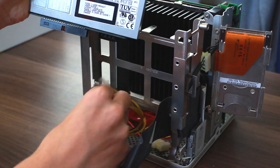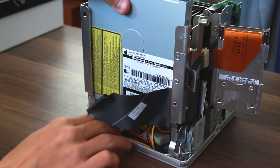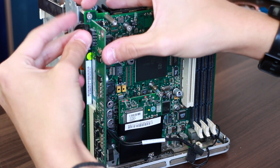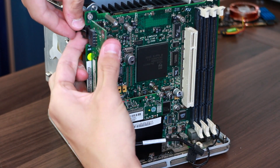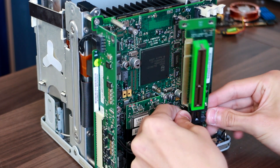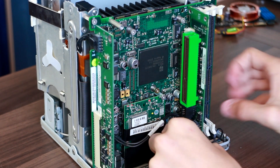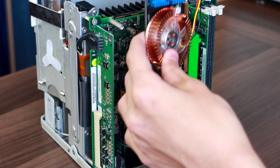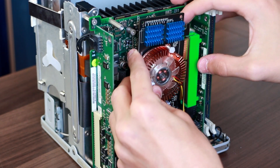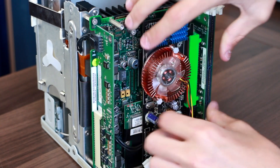You can see here a test fit of the optical drive with the Molex and IDE cables. You have to worry about the cables getting in the way of the fan as well — don't want them knocking against there. But it's slid in pretty comfortably. Now, working backwards, this is the VRM board again — it just slides in like a normal PCI card, quite easy. And that is the Molex connector plugged in. There are the riser cards for our 6200 — it's such a dense system you have to have some at a 90-degree angle. And here is the card itself, the 6200. It just looks so beastly. I love it.